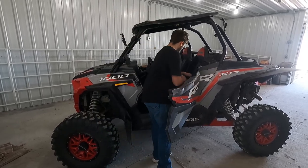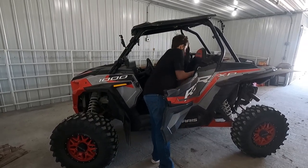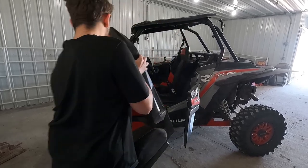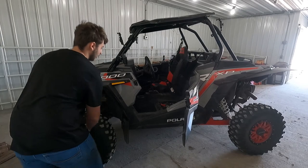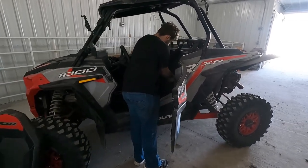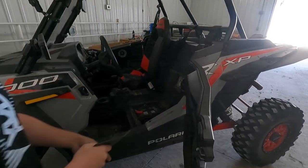In order to do that, you're going to need to take out your driver's side seat. And then there is a cover right over here that you're going to need to take out, and then the ECU is right in there.